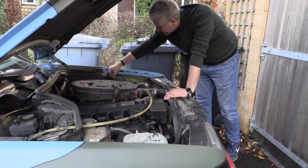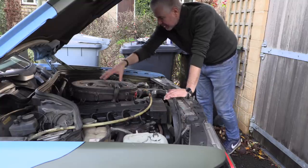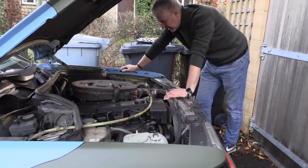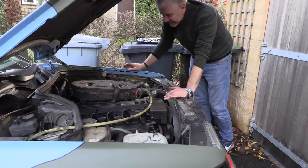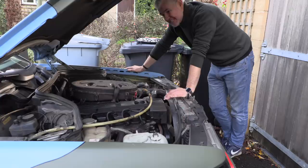These are the sort of vacuum lines that are all over the place. Unfortunately some of them are buried under this air filter assembly and I just can't get to them to test them. If I start the engine with this off then it's not going to run properly anyway, so I guess you'd need a smoke test.